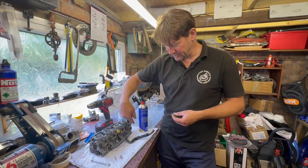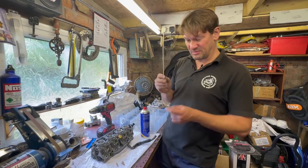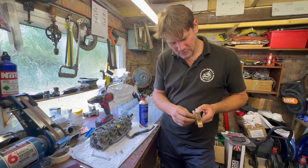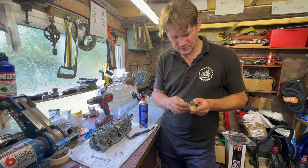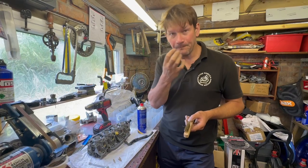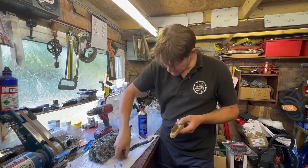Now the pilot jets. We clean these with the jet files — it's a question of giving each one a tiny little clean on the side holes. These have very, very small holes in them. Compressed air is always handy — and on the bottoms of the jets you've got some holes that again we need to go through and clean.